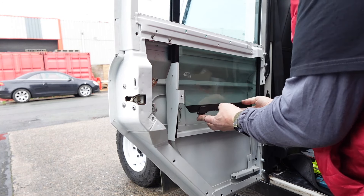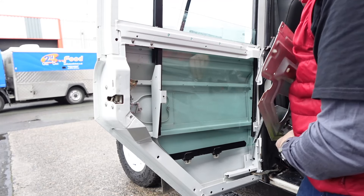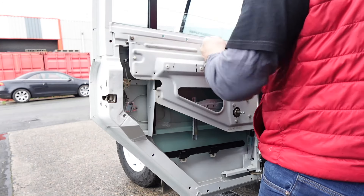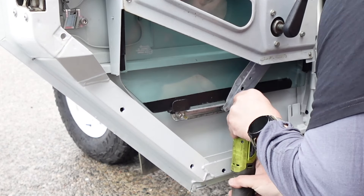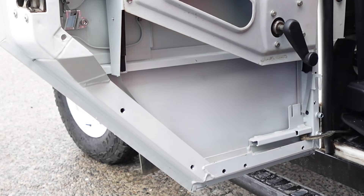We're in position. Let's put our check strap on — not only will that stop the door from sliding, it should stop everything falling out. So we can put the regulator back on. I just thought I'd show you the back here of what it looks like — we've got our brackets all in the correct place again, still running through the channels. Now we should be able to go back on. Just got to put our regulator back in place. Okay, we should be able to go up and down — nice.